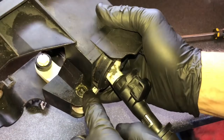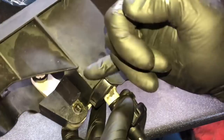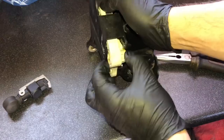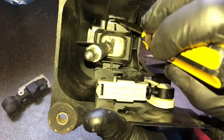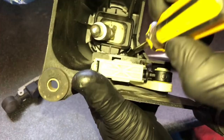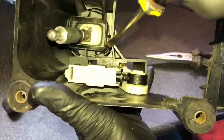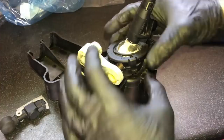Here's the plastic pin that you want to remove. Get yourself a set of pliers or a flat head and push them together — the pin will pull out. Don't worry about breaking it because you've got a new one in the packet. With the pin out, slide this section out and leave it loose. Inside the shifter when it's upside down you can see there are clips — and they're off-center, so you've got to slot and push around to align them, then get your screwdriver in and prise those clips out while pulling the bush at the back.